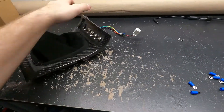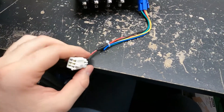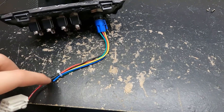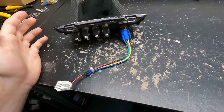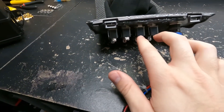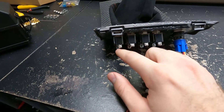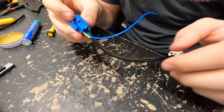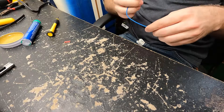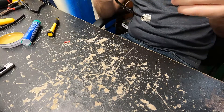Okay, so I got the switch panel out of the car. If you haven't seen the video of me making the switch panel and this carbon fiber bezel, I'll put a card up so you can go check that out. So we have the button and the four switches. This plug right here goes into where my cigarette lighter used to plug in — it's got a 12 volt ignition source and a ground on it. I'm going to use this to supply power to this switch only. I'm going to get a fuse tap that's tapped into 12 volt ignition and another one tapped into 12 volt constant. These two switches are going to be running on 12 volt ignition, and then these two are going to be 12 volt constant. I soldered them together and ran wire loom through the connector, so it's all nice and tidy, and I'm going to have bullet connectors on each of the wires coming from the switches.